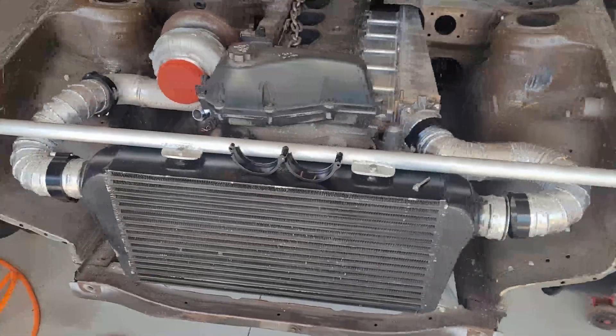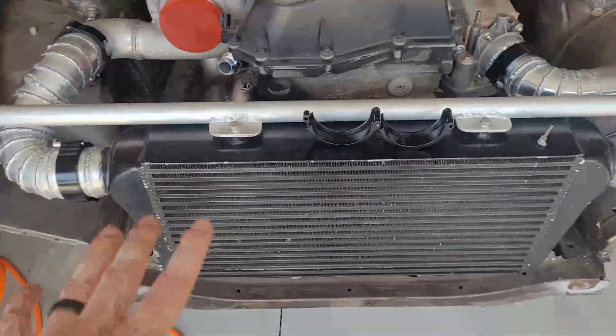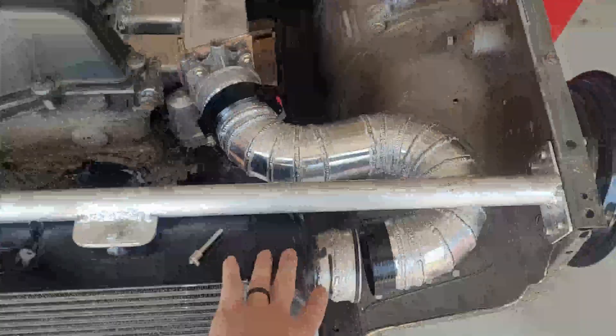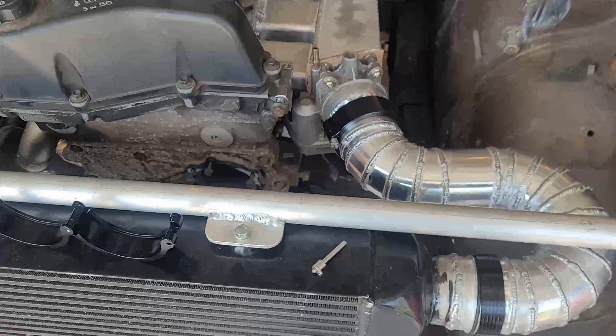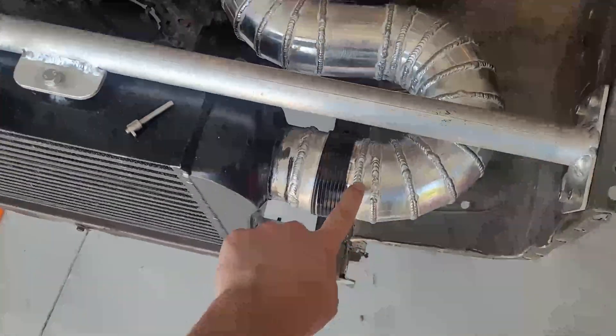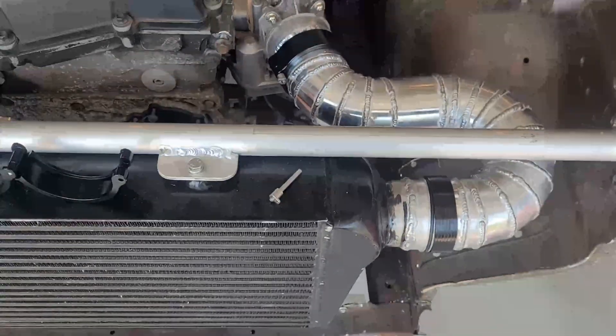So that's the synopsis of the update: the turbo's on, the charge pipes are done, the intercooler is sourced and mounted with a bottom brace all the way across. It runs from there to the factory throttle body, which I also had to weld one of those fittings onto. No hose clamps, no silicone connectors, nothing to blow off — that's the whole point. This is the process it takes to build a car on a budget. You can spend all the money you want and get it done fast, or do it yourself.